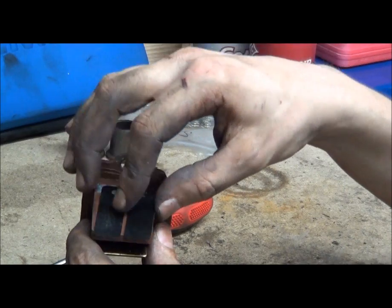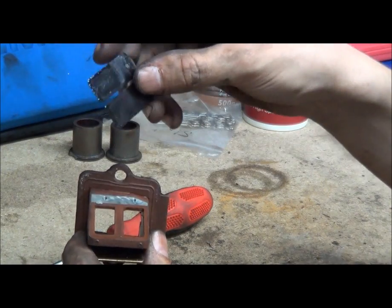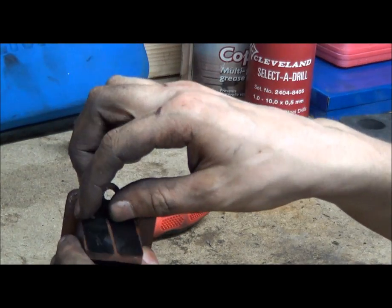So your two petals and your two windows. Some people take this bridge out the middle — as long as your reeds cover it, and you can get single petal reeds, that's fine. But if you have reeds like this, don't take out the middle bridge, because otherwise it won't seal properly.